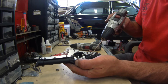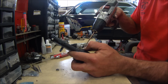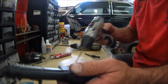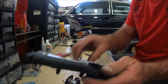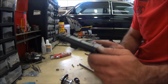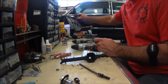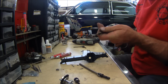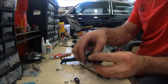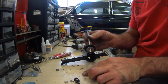No matter how good you drill this tube, it might just need to be tapped in with a hammer. There ain't nothing wrong with that. A nice, tight fit. If it weren't for people complaining, I would make them both with a hammer tight fit. If I make something for my cars, I will typically make them with a hammer tight fit. So if I'm making a shaft that goes in these lockers, I make it so I hammer it, literally, because then it doesn't wear out.